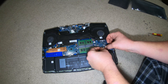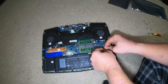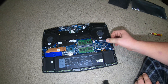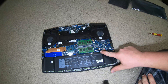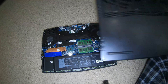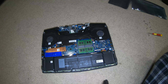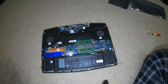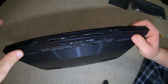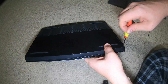This connector is not used to being bent. Just line it up, push it down. There we go — just push it in. Push it down, make sure all the wiring isn't coming up too high. I don't think that really hurts anything. Put the lid back on — the cover, whatever you want to call it. I'm going to blow that out a little bit — there's a little buildup on the inside from the fans. Push the top end first, push it in and down, and then push this end down and screw these in first.